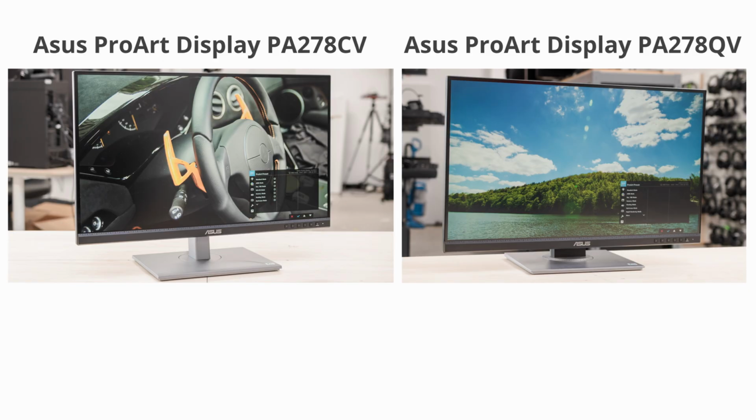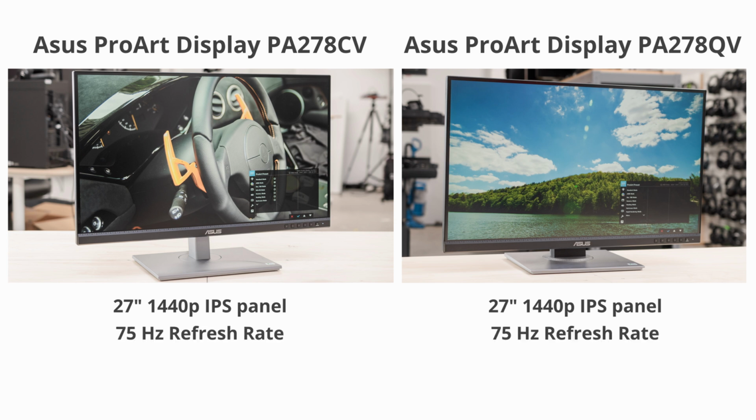This monitor is the successor to 2020's ProArt PA278QV, and they are very similar. They're both 27-inch 1440p IPS panels with a 75Hz refresh rate. The biggest difference between these two models comes from their connectivity options, with the newer model getting rid of the DVI port and adding in a USB-C port for use with modern laptops. The ProArt is a good entry-level display for media creators, and it also features a few gaming features for your downtime, which we'll talk about in the review.